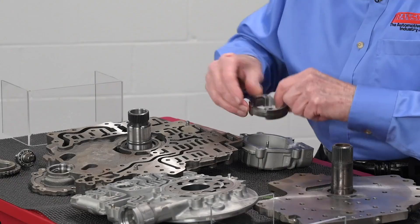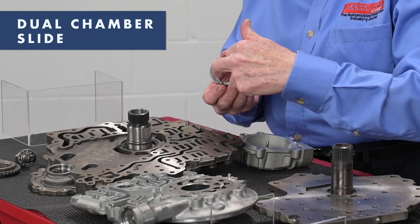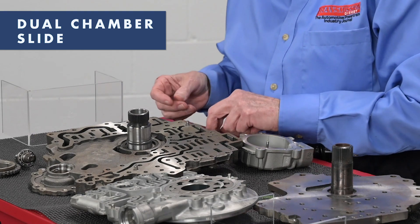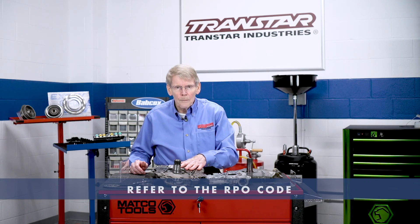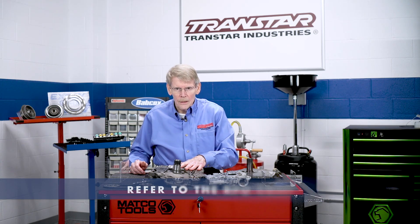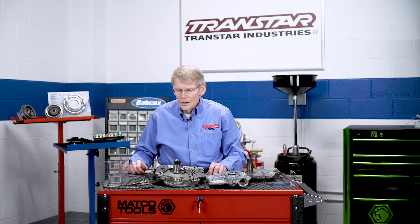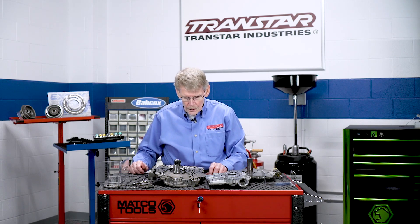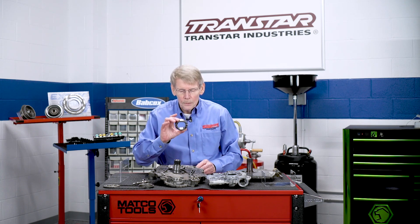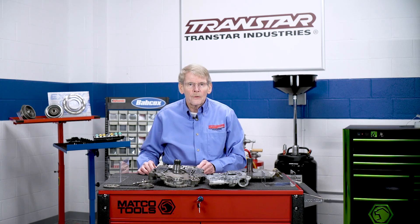This slide is actually a dual chamber slide, so there are actually two chambers responsible for pumping transmission fluid. Refer to the RPO code so that you know what design you're working on, because if you do have a pump issue, you can tell there's a distinct difference between them. Just be careful when you reassemble these that the slide is put back in and that the gasket is also put back in in the right direction.